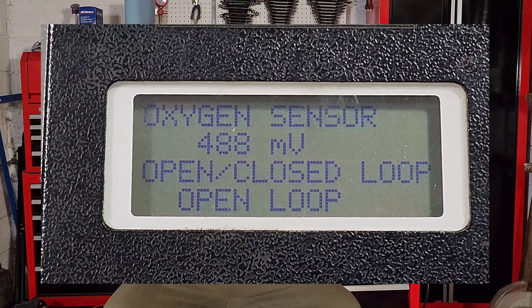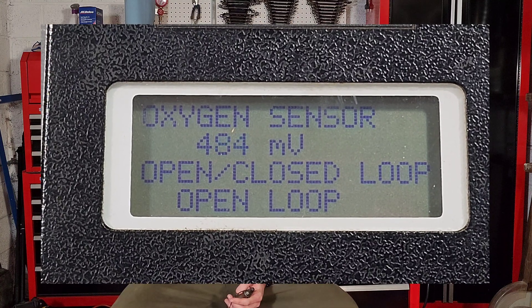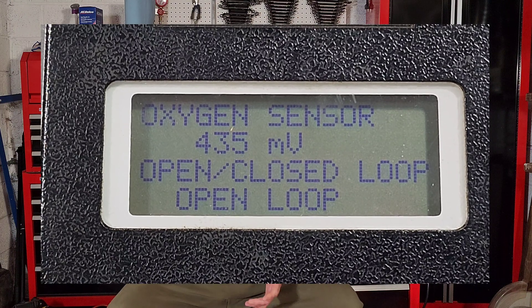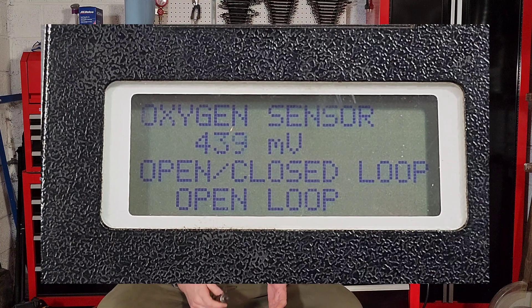The engine is actually going to disregard the reading from the sensor when it's too cold — usually right after startup. But also on some cars, when the car has been idling for a while, the sensor will actually cool down and you have to do some driving before the car goes back into closed loop mode. When the engine is getting a usable reading from a hot oxygen sensor, the voltage will fluctuate rapidly.